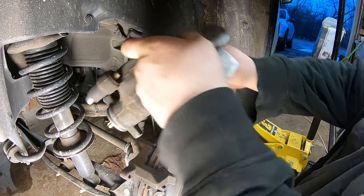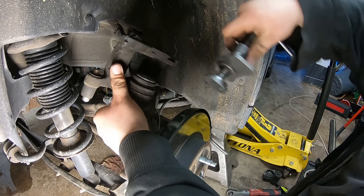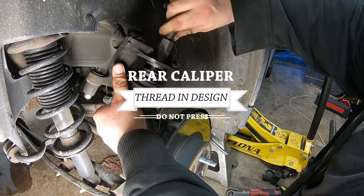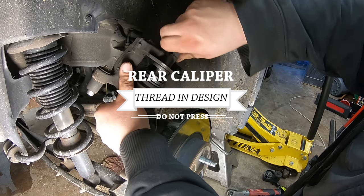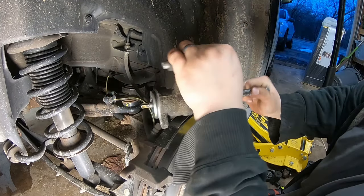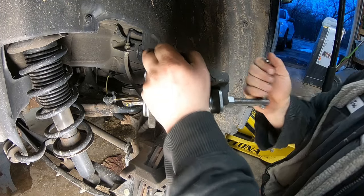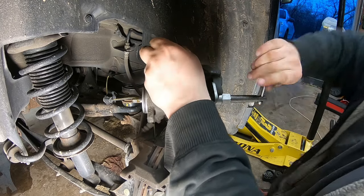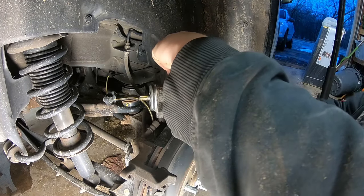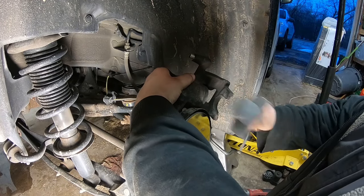So now, using a special caliper retractor tool, I'll have a link in the description to this one. You're gonna twist. You can't just push this caliper in. You gotta spin it into the right. So this is a special tool designed to spin the caliper back in. And eventually you'll see it catch the actuator piece, and that will start to turn as well, as you can see. So you're just gonna spin this all the way in. Caliper all threaded in now.